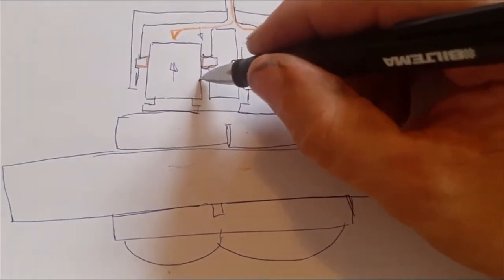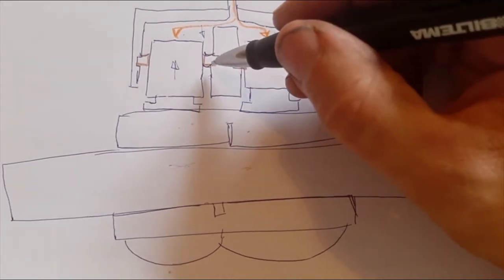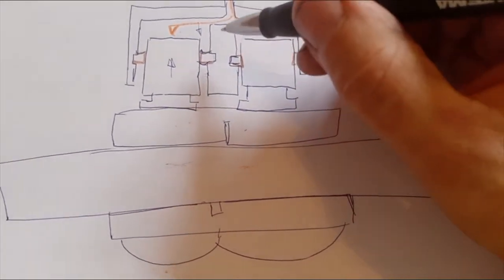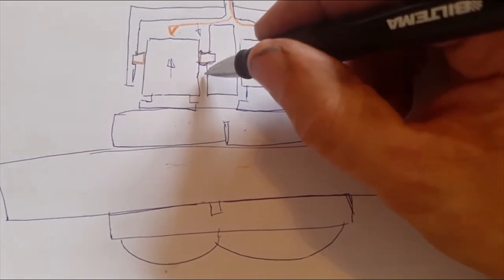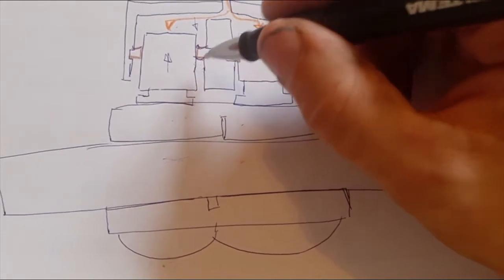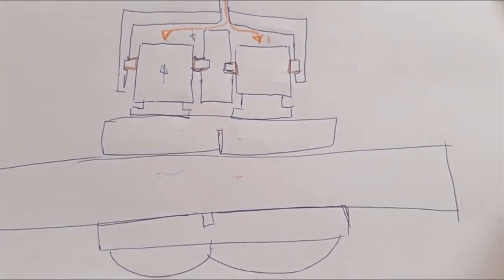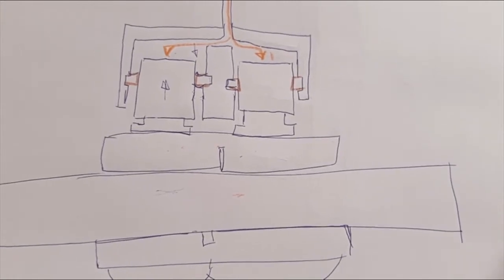There is a certain tolerance which is supposed to be here. Of course, I have exaggerated the look of it just for the purpose of this explanation, but the plastic pistons typically run a looser tolerance between the bore than a steel piston should have. So when we're changing the piston, we want to put a slightly bigger steel piston in there.